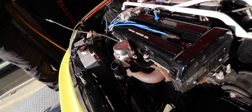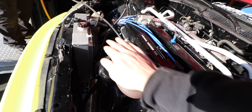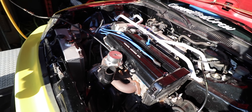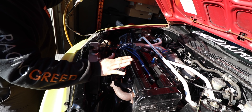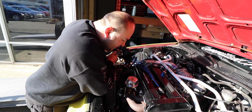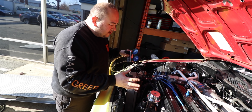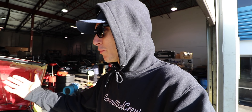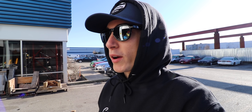Test number two - hopefully we just don't hear anything now. That'd be ideal. So it's leaking out of the valve - it's the valve of the wastegate itself. We checked how much boost it needs to open up - it started opening at 30 psi here, which might be 15 on the car. It's time for a new wastegate. I don't have tools like that so I just took it apart and looked at it and thought it looked okay. Sometimes you just have to admit a loss and let someone tell you what's wrong. I'd rather just get a wastegate and call it a day. We're going back on the dyno one more time to do a couple pulls and see if putting that crush washer on helped at all, and then we'll have to come back after we get the new wastegate to see what power we actually make.